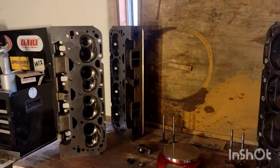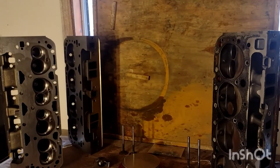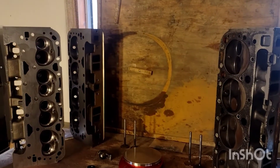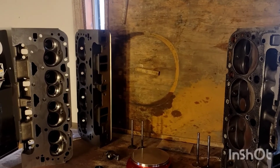Let's start off by looking at the cylinder heads themselves. We can run a stock GM cylinder head, but if we do that, we're restricted to running heads from the smog era that really don't flow all that well and are starting to get hard to find on the used market.